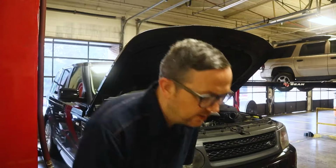So, got to looking, found a technical service bulletin, and the TSB that I found was LTB00643NAS1, and it was issued in February of 2014. This has to do with a battery charge warning lamp on with DTC B11DB/87, which is a code that can set in your body control module. This ended up not being the problem that we had, but I do want to go over it because I think it's important that you look at all options before you start condemning these $400 or $500 alternators out there. And this could be a problem that's causing the alternator not to charge.